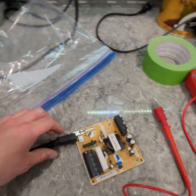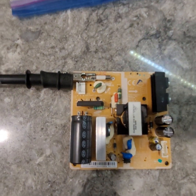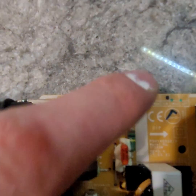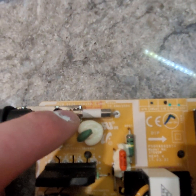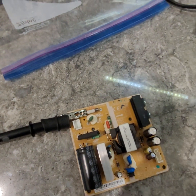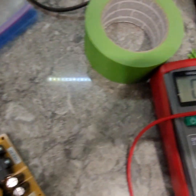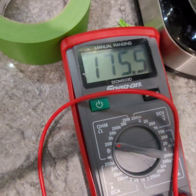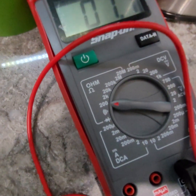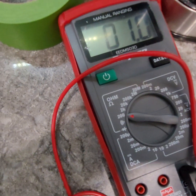So what I did is I tore it all apart, and the part that I found was faulty was this little circuit board here. What I can tell was wrong with it is you can see on this board there is a soldered-in fuse. I'm going to touch my leads together and there should be just a little bit of resistance. When I touch my leads together I've got resistance — note the scale too, on a manual ranging meter you want to make sure you have it set correctly.